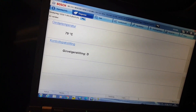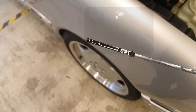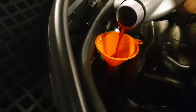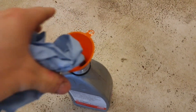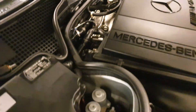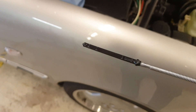Let us check the level. Put it in neutral — just at 80 degrees. I can actually feel it just a tiny bit. Rechecking — 81 degrees. Dry off the dipstick, insert it down like that. Between those two markings there. So this is good — great success.